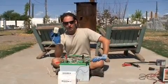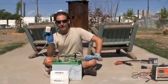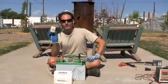These are nice because they have no smarts in them — this will keep charging a battery. You'll want to check on the battery at least every 12 hours and make sure there's no heat coming off the battery and that the voltage of the battery looks reasonable, below 15 volts.